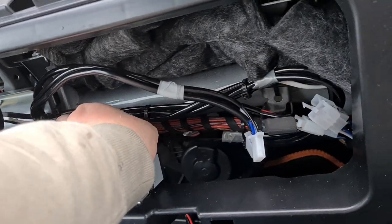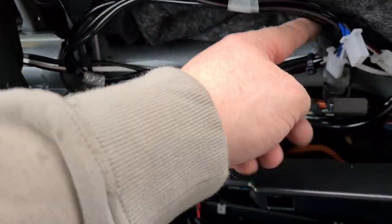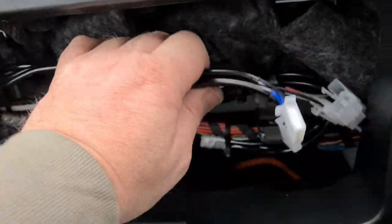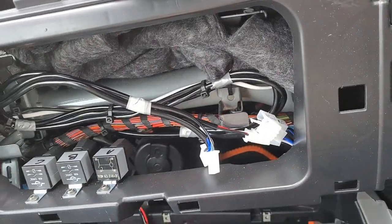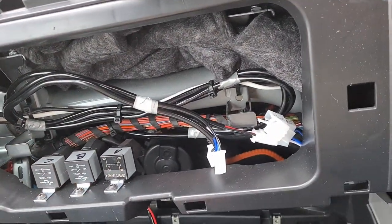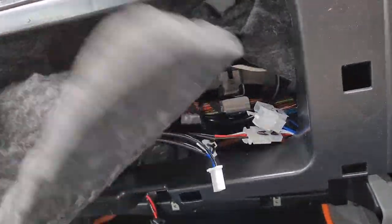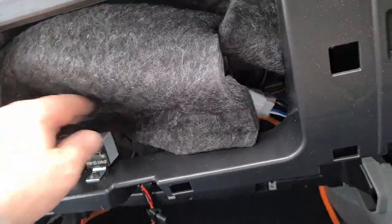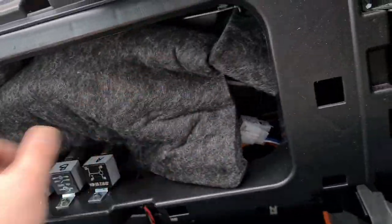Just loop the cable tie around, find a gap in the cables and pull it through. I've dressed the slack up from the cable so the loom comes along the bottom and loops back around underneath, because we have quite a bit of slack on the switch side of the loom. This is a perfect area to hide it all — put it in there, keep it tidy, drop the cover back down when we're finished and that'll cover it all up nicely, stopping it rattling on anything. We'll keep it off the relays and tuck it around the back to let the relays dissipate heat.